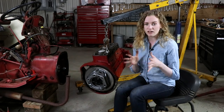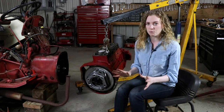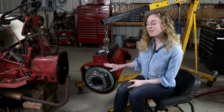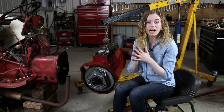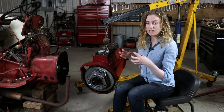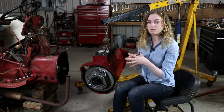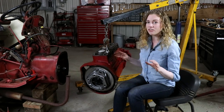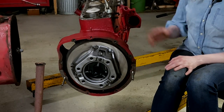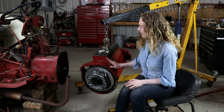If you need more help on a clutch replacement, I have a separate video on my channel that goes into a lot more detail about throwout bearing and pilot bearing replacement. I put a little bit of anti-seize onto the splines here just to help it go together smoothly. When I put my two parts together, I'm making sure that they go together easily — I am not going to force it at all. I'm not going to put my bolts in and make the bolts do the work of bringing the two halves together. I have some dowels here as lineup tools to help me get it into place, and with all of that, I'm ready to put the engine onto the transmission.